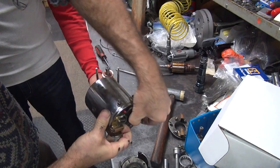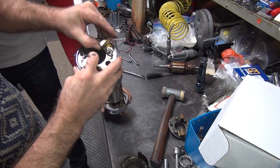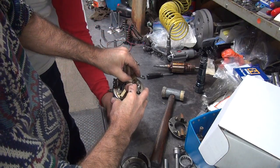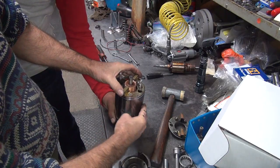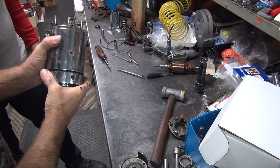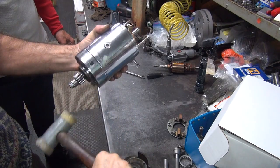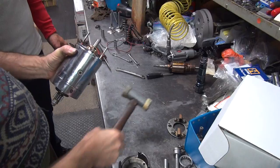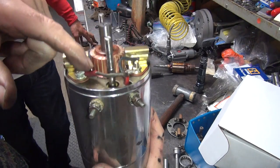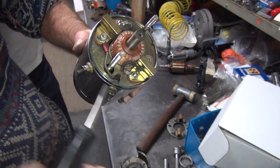Where's my mark? I want the mark right over here. These two studs go through these two big holes. Once you're on the armature you're fine. There's the notch up — right there's the notch. Easy to just fall right together. Now when you're all in here, make sure the brushes do not hit up against the armature. You've got the shoulder here on the armature — make sure the brushes aren't jammed against it.